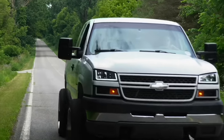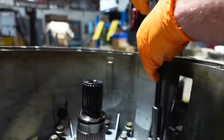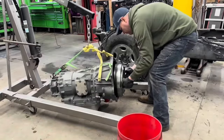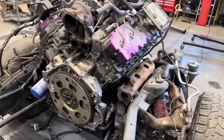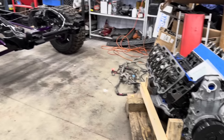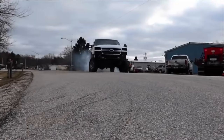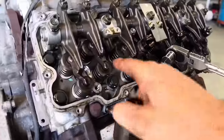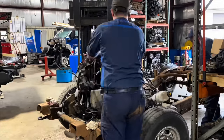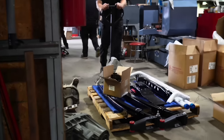So there's no real way to actually diagnose the CP3 unless you bench test it, unless you actually pull it out of the truck? There are ways - I would have to go back and look that up. We just had to do this on an LB7 last week and I had to reference my notes from like 10 years ago from a training course, because it's been a hot minute since we ran into it. We were able to isolate - it was like 100 milliliters that needed to be returned back total. Then there were steps that you'd break down on the LB7 side to isolate: is it the injectors or is it the CP3? The tech went through it and we said nope, it's definitely a CP3 issue. Sure enough, he finished the truck and it fixed all the issues - the truck runs great and we never had to touch the injectors. So there are tests.